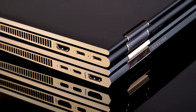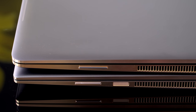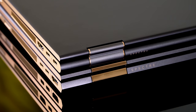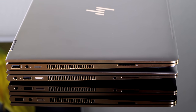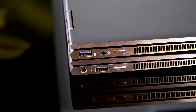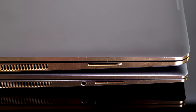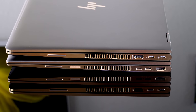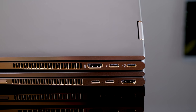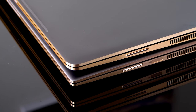If you look at it from the sides, you see the same ports and controls. The only addition is a fingerprint scanner on the side edge of the machine, which is not the most convenient place for it. You still have two Thunderbolt 3 ports supporting four lanes PCIe. One USB-A port, a full-size HDMI jack, an SD card slot, and of course a headphone jack. Anything else you need, you can use USB-C dongles. It's USB-C Gen 2 supported with those Thunderbolt 3 ports.